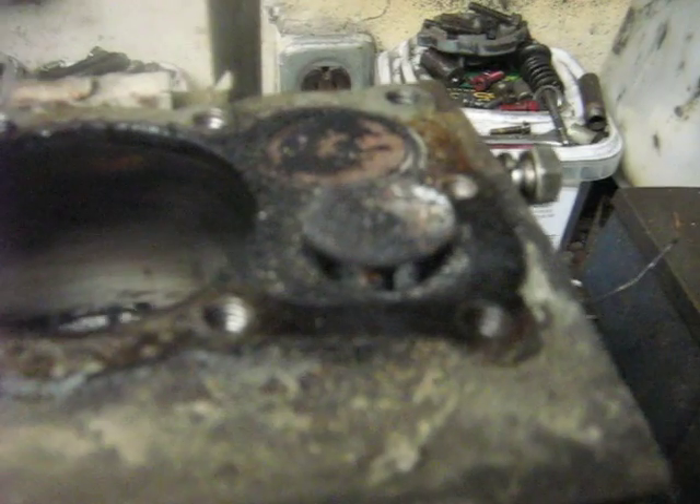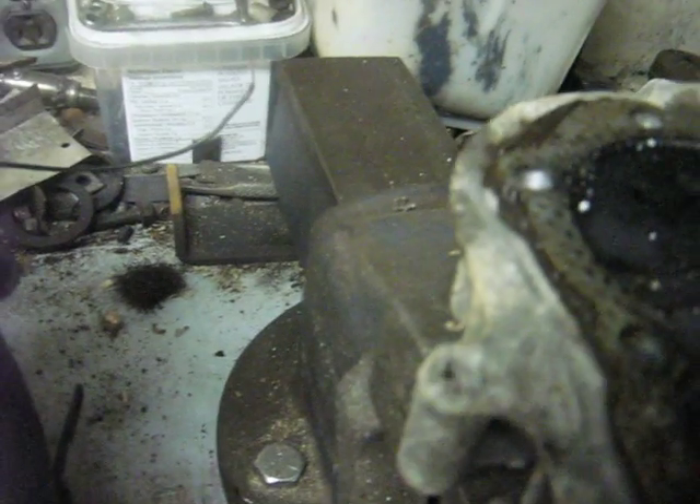You can see all this crud here. Maybe the exhaust valve was open and a bunch of crap blew in, and then when the piston came up to the top it jammed against the head. You can kind of see some stuff stuck to the head there, so that's what I suspect was stopping it from turning over.